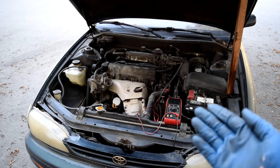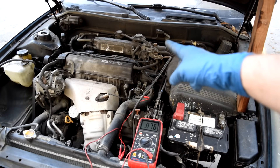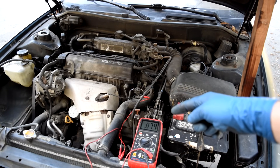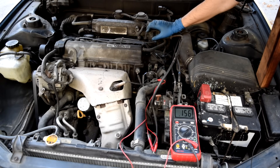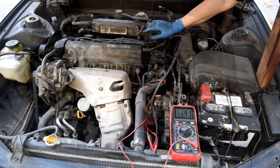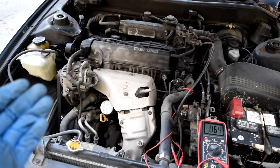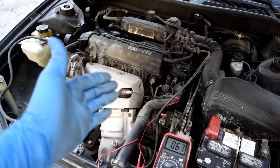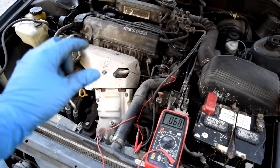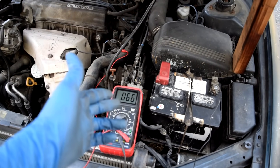Before condemning the O2 sensor, make sure it's actually the sensor and not the car running very lean. I'll rev the engine by opening the throttle to see if that changes the reading. As you saw, the sensor is capable of reading higher voltage but isn't doing so at idle — meaning the engine could be running lean. In this car's case, I believe it's a leaking exhaust manifold gasket introducing outside air into the exhaust system, lowering the oxygen differential and producing a low voltage reading.